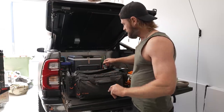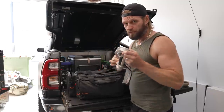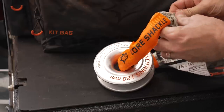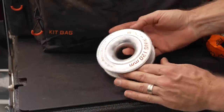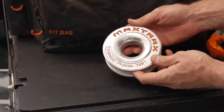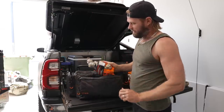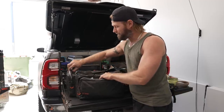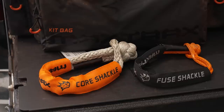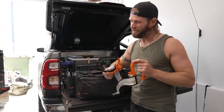Moving on to all the accessories needed for recovery. I have a winch, so therefore I have a winch ring — much lighter and more compact than those big snatch blocks, and it already has a shackle on it so we're ready to go. In the big pocket on the front I have all my extra soft shackles. These are the core shackles at 14,000 pounds, compared to the fuse shackle at half the strength. So why would you have a fuse shackle? Stay with me and I'll show you.